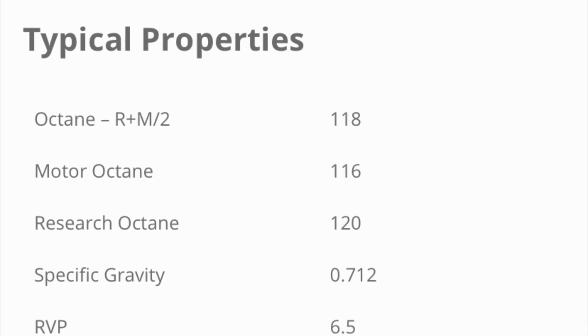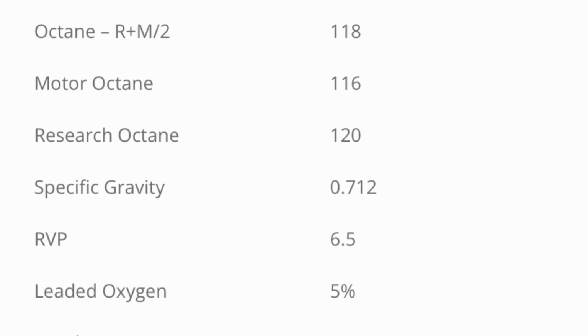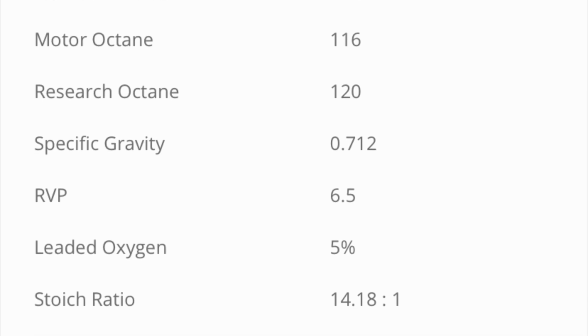I'm going to give you a tech spec sheet from the back of the Renegade fuel that I'm using, which is the RM K16. I'm going to put that on the screen for you now, and then I'll talk you through the things that I am going to mention: specific gravity, the RON, the MON, the stoichiometric air-fuel ratio, and also the oxygen content. I'm not going to mention the lead content, although your engine tuner and your race fuel vendor will let you know whether you need a lead additive or a higher or lower lead content for your specific car. That will be dictated by what type of car you're using, and they'll let you know about that anyway.